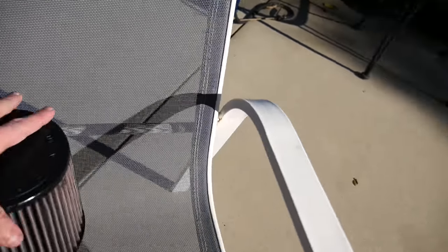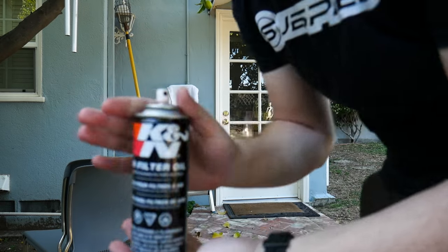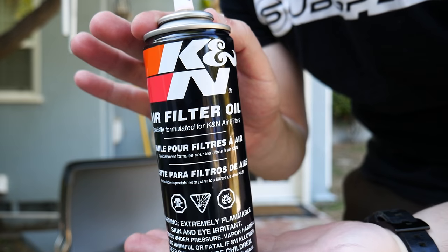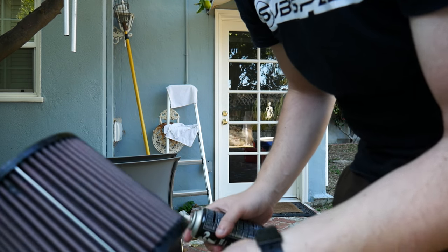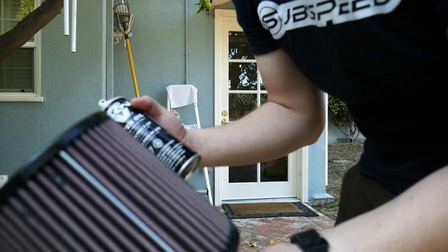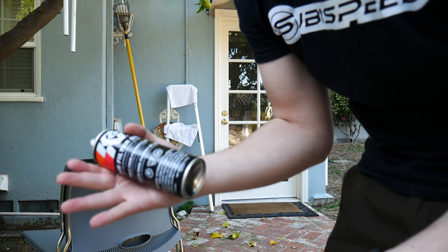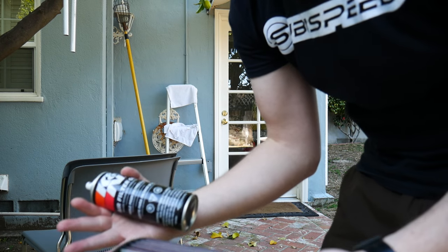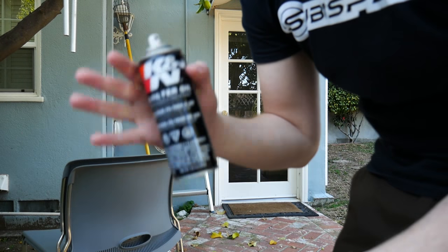This has been sitting for about 30 minutes now — it's all dried up. That tackiness is like oil so it's not actually wet. Let's get this oiled up. The oil is in the aerosol can — looks like this. All we're gonna do is evenly spray a nice thin layer. Less is more — you don't want to over-saturate it and get oil seeping through onto your MAF sensor, because you'll have all sorts of problems and have to clean your MAF sensor. I've been there, done that.